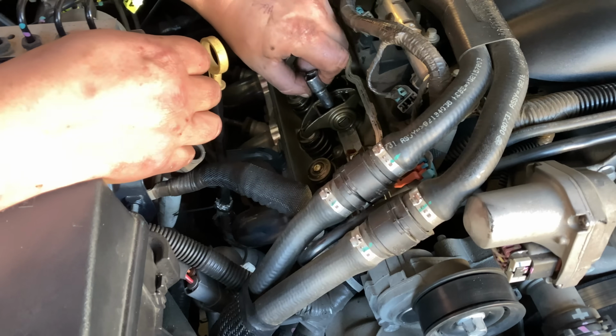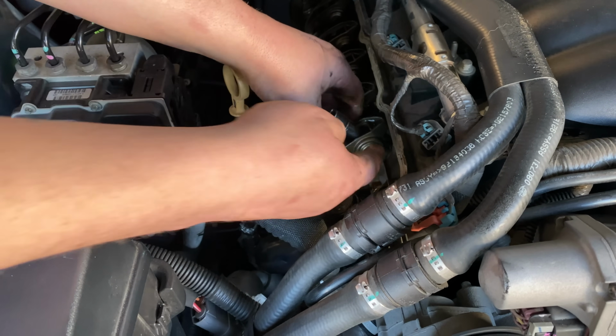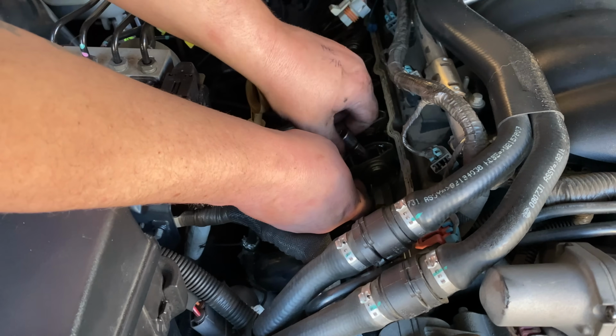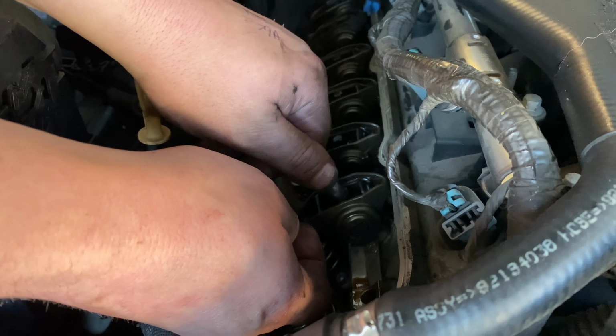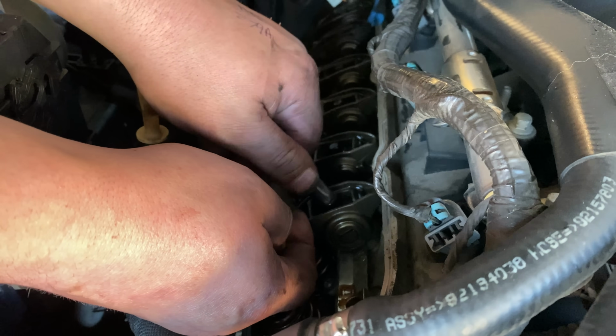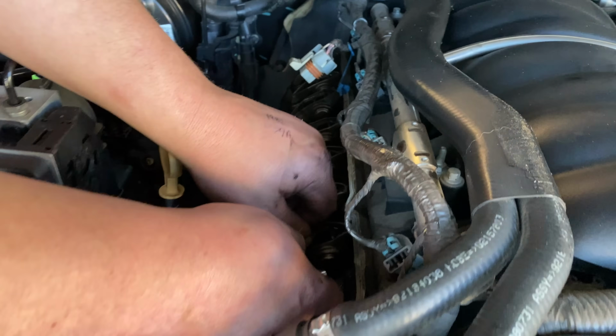What are we actually taking to give to him? I don't know. Do you just want the rocker arms? I presume he's just going to upgrade the trunnion. Yep, that's exactly what they're doing. Because the stock rocker arms are actually really decent, just the trunnion in there is weak. So if you're going to be revving it excessively, which we will be, they might break.